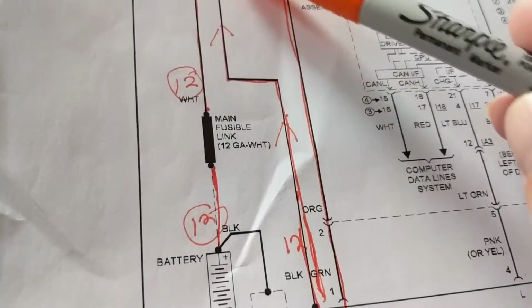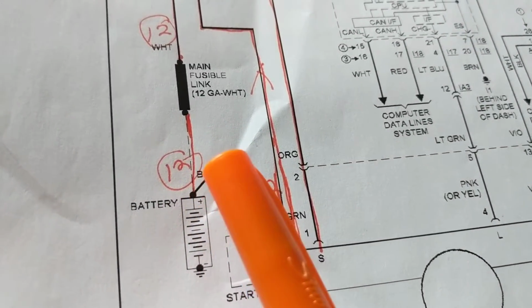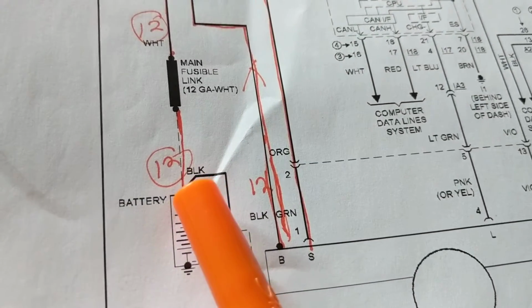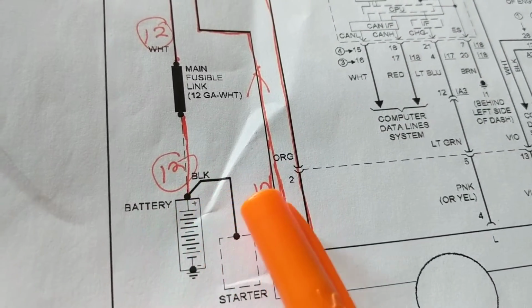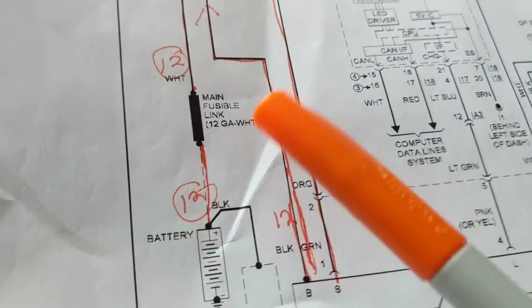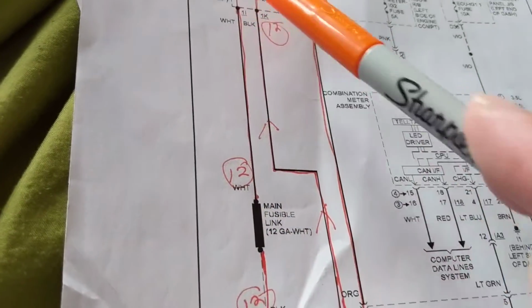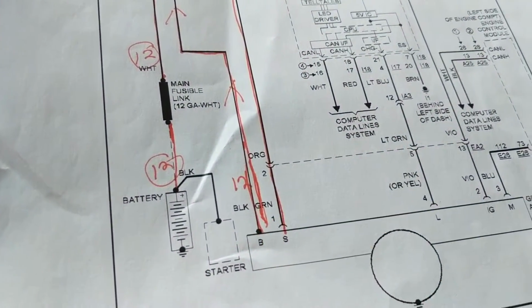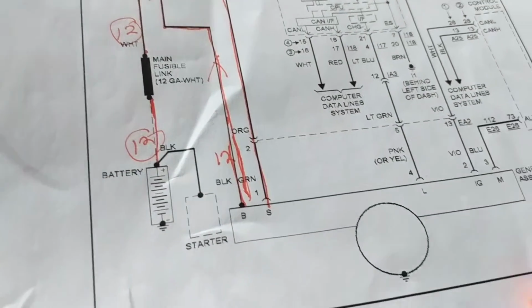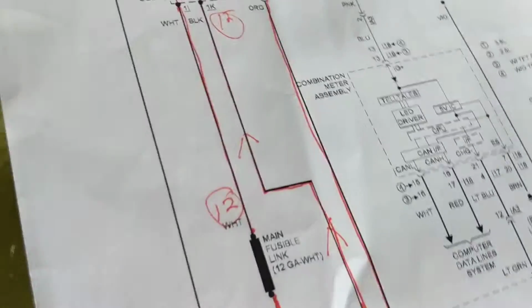But if you're in a repair shop or wherever you are, I want to make sure that I have 13 volts here or 14 volts over here if I'm able to crank it. If it starts and it doesn't work, and I get nothing here or very low voltage, I'm suspicious that I'm losing something through this, or through that wire, a large voltage drop, or corrosion over here. I am suspicious. So don't be fast to say alternator. This is the point I'm trying to make.